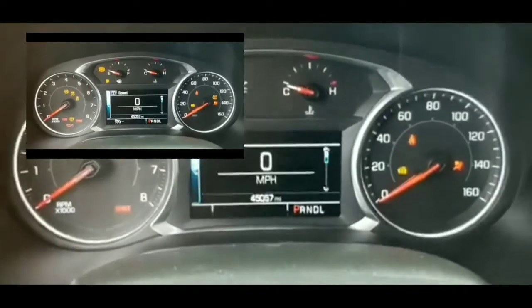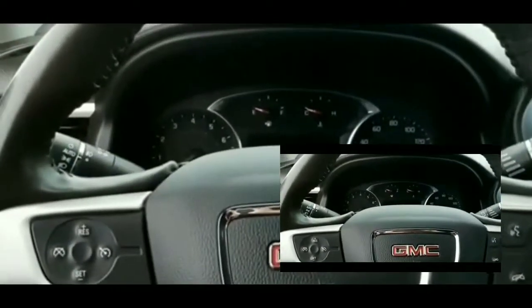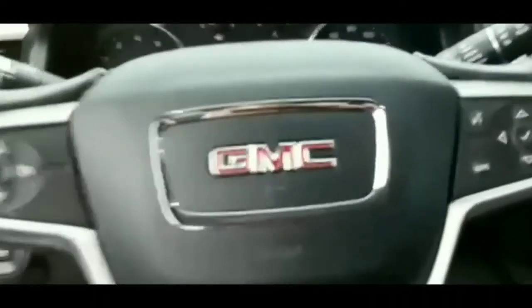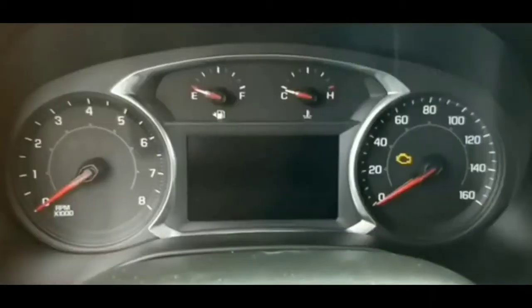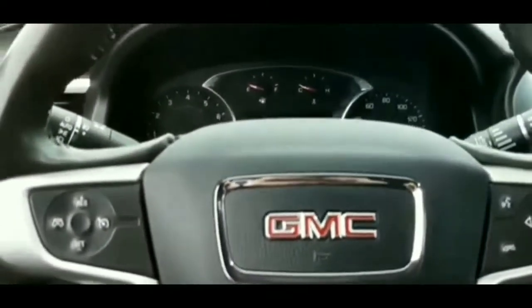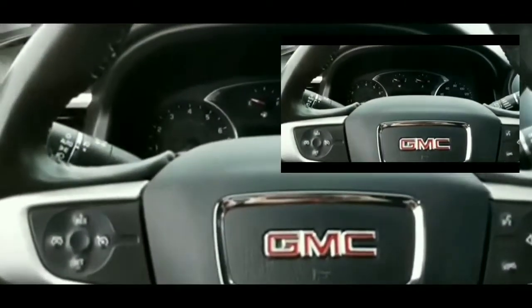Outside of that, the only problem that I have is the engine isn't starting. It's not cranking. It's not turning over. It's just one single click. Every time I try to turn it on, it's click, click. That's all I hear. Sometimes I don't even hear that. I don't even know where the click is coming from. I'm just a little bit confused on that.